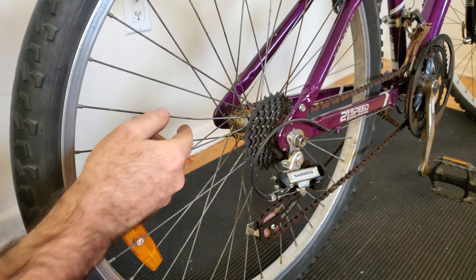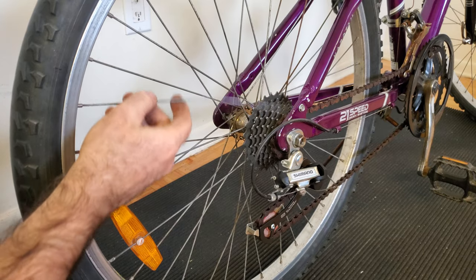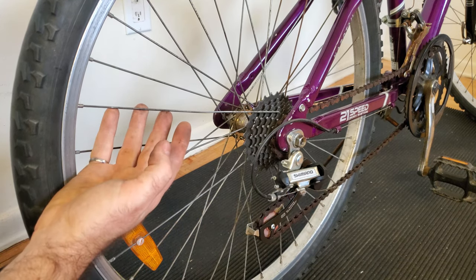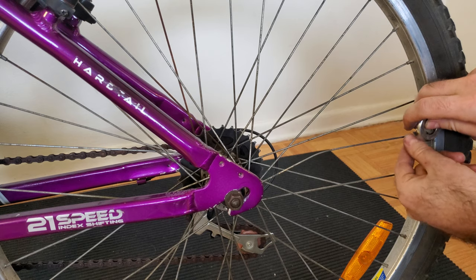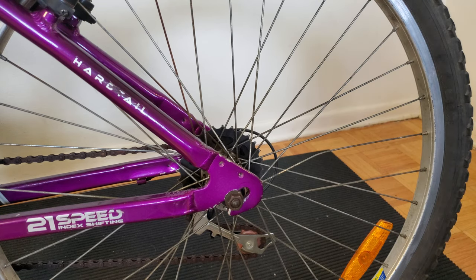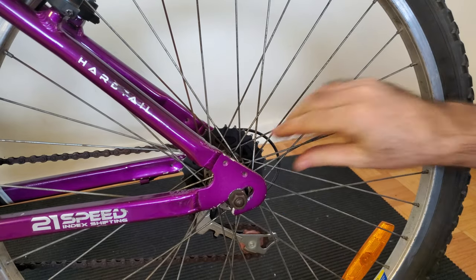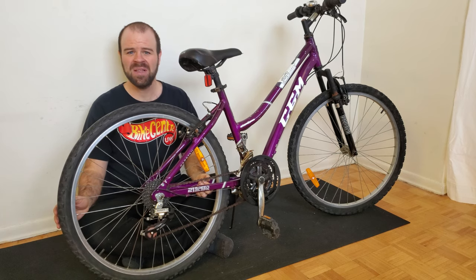Another important thing to be aware of is that a loose broken spoke can cause further damage to a bicycle. If you were to continue riding with this loose spoke dangling and rotating around, there's a good chance that it could get snagged on something such as the rear derailleur — and if it does that, there's a good chance it could destroy the rear derailleur. I've known of rear derailleurs being totally ripped off from a loose spoke like this. So if you're out riding and you notice that you have a broken spoke, you should stop and deal with it immediately before the problem gets worse. If you have a spoke wrench with you, you can use it to extract the existing spoke. If you don't have a spoke wrench, I recommend taking the old spoke and wrapping it around some of the other spokes to keep it from getting snagged on anything. Anyway, that concludes this tutorial. If you have any questions, please let me know in the comment section below, and thanks for watching.